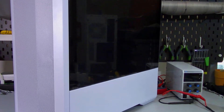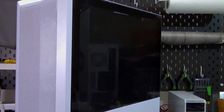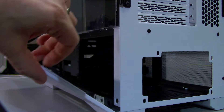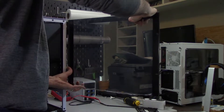Moving on to the right side of the case, there are two side panels — one steel and one tempered glass — both held in by magnets. To remove the glass panel on the right side, you first need to open the lower steel panel by pulling the small tab at the rear of the case away from the chassis. You can then swing the glass panel open and, once it has swung open more than 90 degrees, slide the panel up and lift it away. Make sure to have some weight on or in the case, as it is possible for the case to tip when lifting the glass panel.